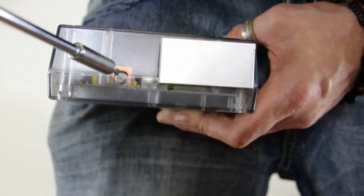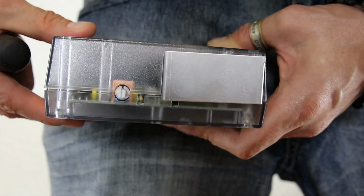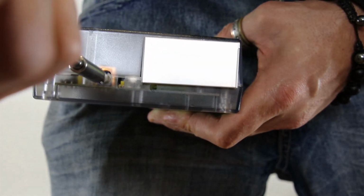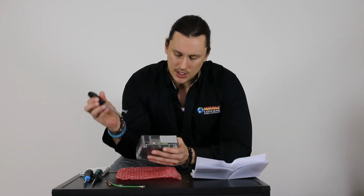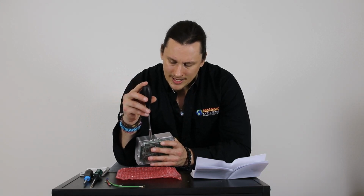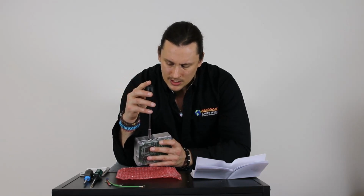So it's important to note that the stove will not operate correctly, doesn't matter which model you have, the way that the control board comes out of the box. So it is important that we take a look at the instructional sheet and make sure that we're setting this dial based on the stove that I have. Again, I'm just using a small flathead. You could use a precision flathead, but this is just a plastic dial inside here that I'm turning.